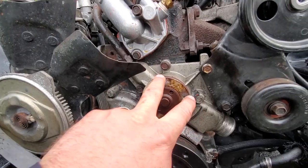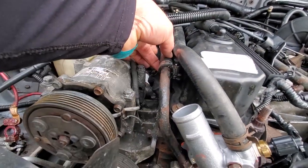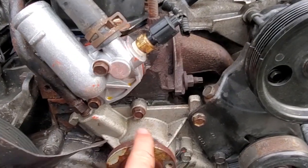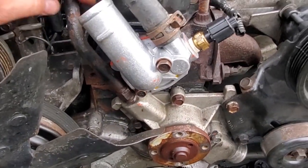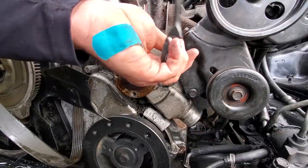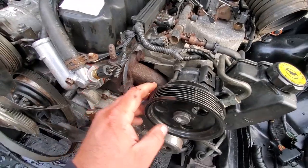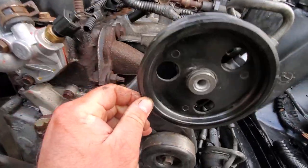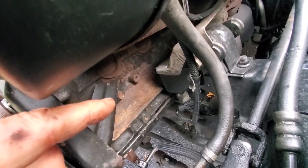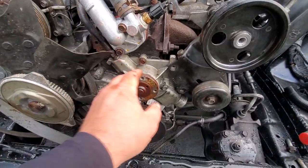This XJ has one of these inlet tubes right there, so we're going to have to disconnect this hose from the heater core. That tube comes right off with the power steering pump — no need to worry about it just yet. We're going to remove these three bolts — one, two, and three in here — and then there's one way back in there. Take that out and this whole assembly just lays down right there, giving us easy access to the water pump.